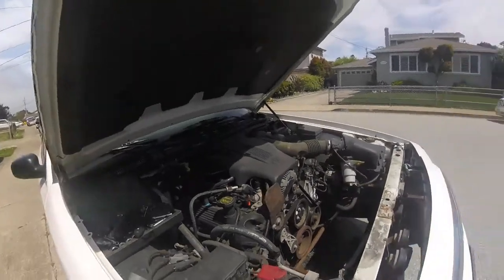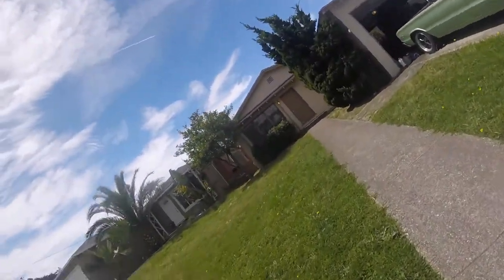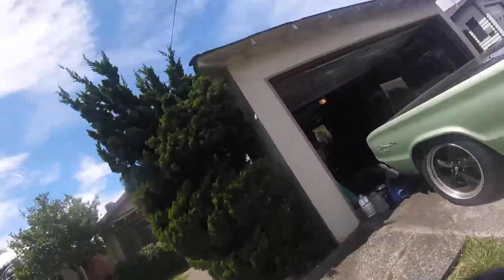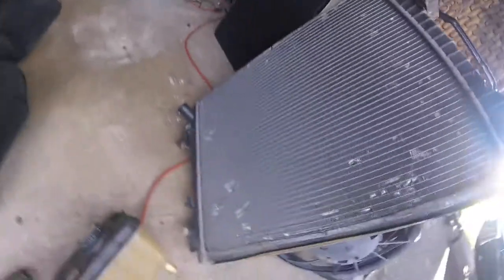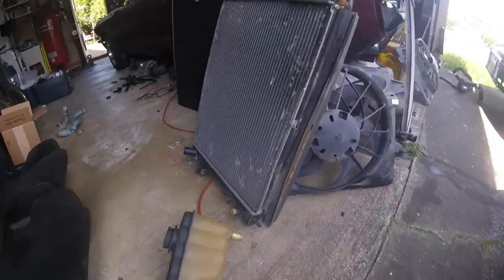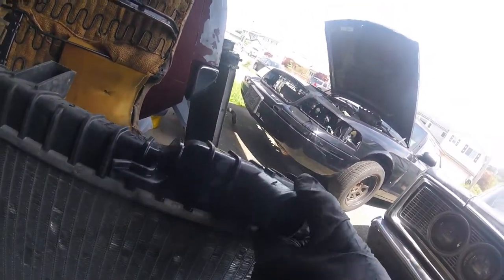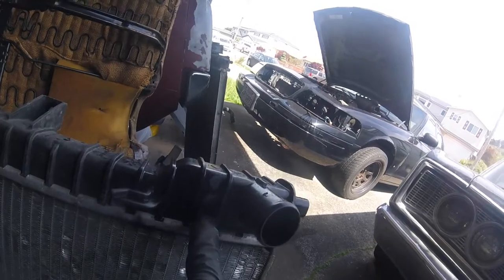Now on to the white car — got it in the same condition, everything out. Looking at the radiator, I can't see any visible cracks in it. I'm thinking the hose clamp or the hose might have just been cracked. That kind of sucks if that's the case, but on the other hand this radiator definitely looks a little worse for wear, so I'm gonna go ahead and swap it out. The leak was happening right here — I think it might have just been a hose clamp failure. But I'm not gonna take any chances; I'm gonna put the known good radiator in. But first, I'm gonna eat some lunch. Two hours later.